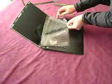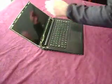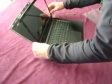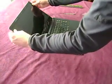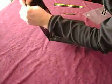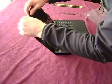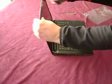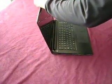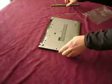I'm going to remove the protective cover, and then we can put the bezel on. It just drops down into the hinge area, and then you just start pushing the snaps back into place. When it's done properly, there should be no gap all around the edge. Now you just want to put your battery back in.